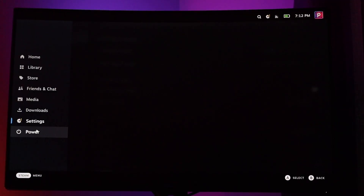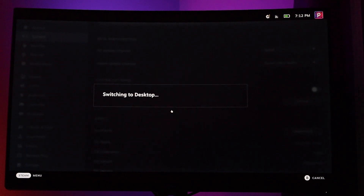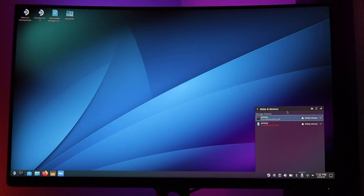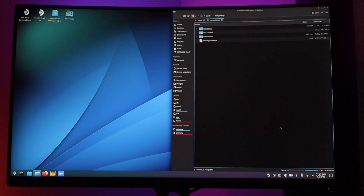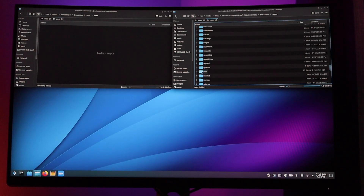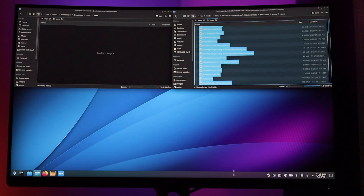At this point, hold the power button on the Steam Deck and tell it to go into desktop mode. In the lower right corner of the screen — kind of where the system tray is on Windows — you'll see it pop up disks and devices. You'll see the old card listed; just click the mount and open button. Then you can open both SD cards the same way you would on any other PC and copy the files from their respective folders into the same folder structure on the new card.